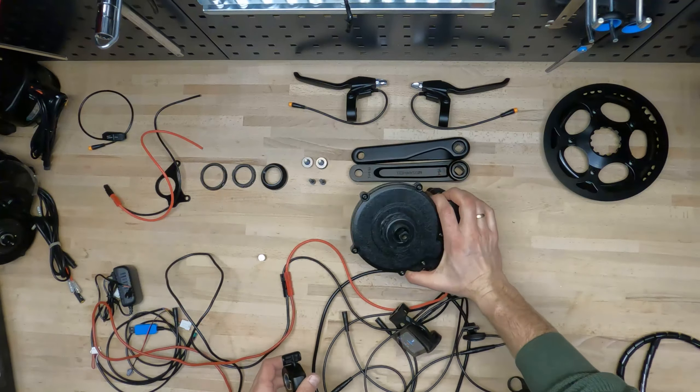Now we can open the controller — very long screws. Oh guys, this is like... it sucks. How can it be? For me it's totally unreal. Water comes inside this area, so if you don't cover this area, everything goes inside the motor — water will be inside the motor. I wouldn't rely on the seal. I can see transistors. So again, waterproofing is a big disadvantage of this motor. In future, it cannot handle the water. I don't know why they made it like this. I'm shocked.